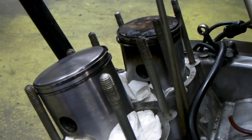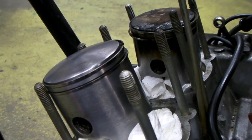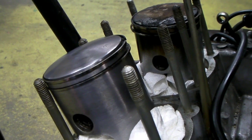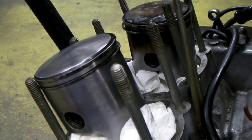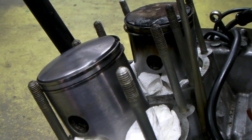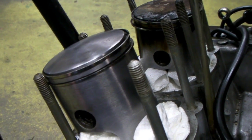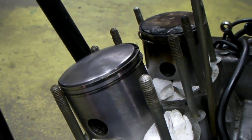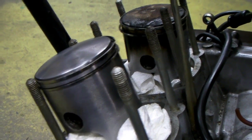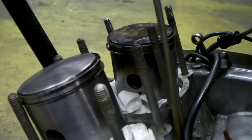I take these rings off and scrape the carbon out of the grooves, going around with a dental pick. I use a little bit of decarbonizing stuff, a carburetor cleaner. If you've got some that you can soak, some of them come in a gallon can with a soak basket, and that works real well to soften the carbon. But you've got to go around there with a scraper to get it off. Some people recommend using a broken piston ring as a scraper. I use a dental pick, and that works pretty good, particularly after you get the carbon softened up. As far as taking it off the piston crown, I put it in the sink with a little bit of water running on it and some wet-or-dry sandpaper, maybe about 180 paper, and rub it around — the carbon comes off easy. It's getting it out of the ring grooves that's the important thing.